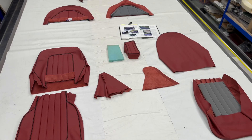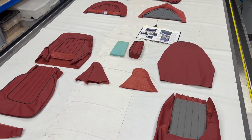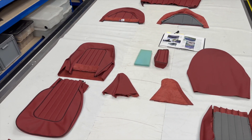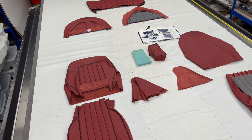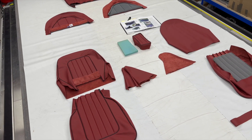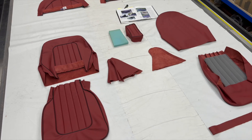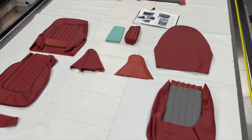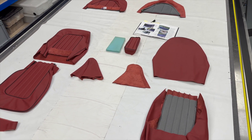This kit has been done in full leather, not to be confused with the OEM spec leather which we refer to as leather-faced. This is a special order where there are no elements of vinyl on these seats whatsoever — everything's in leather, barring the piping which is leather cloth. The OEM spec was leather-faced, meaning the main bits that touch your body were leather, but a lot of the surrounds, retainers and finishers had elements of vinyl. It's worth noting that a lot of other companies refer to their kits as leather but that is what we call leather-faced, so bear that in mind when comparing kits.